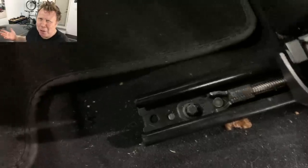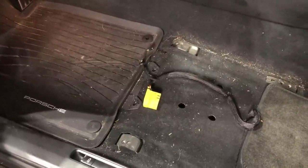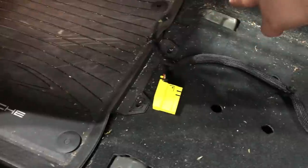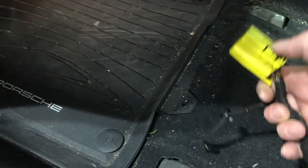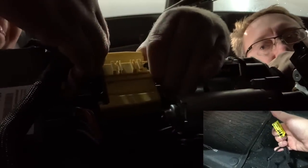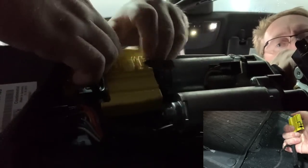At this stage of the video, we've got the seats out. It took a while. Patrick came over to help because first off I didn't have the doobery to remove the bolts — they were a special bolt, E-sockets, and I didn't have them. Then he decided to stick around and gave me a big help. Never underestimate how dirty your car is going to be when you remove a seat — good lord. You can see where the bolts go into the frame: there are four of them, all the same. The wiring harness was tricky to pull out because the black clip couldn't be pulled out all the way without moving it away from the motor to get some leverage.